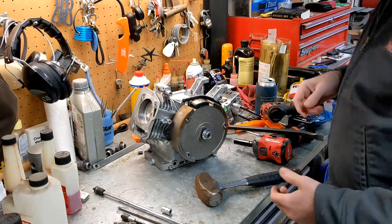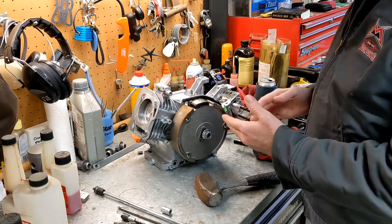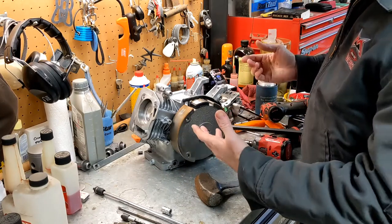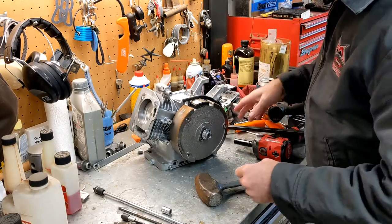If you break the magnet, it causes a break in the magnetic field. And the thing wouldn't fire correctly. It wouldn't fire at the correct time. It wouldn't have the right duration. And it could maybe even make it fire twice, although they'd be right on top of each other. That wouldn't matter too much.